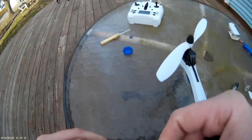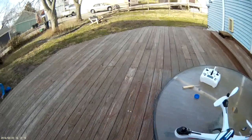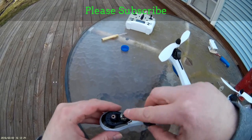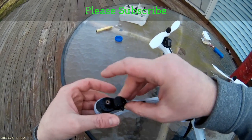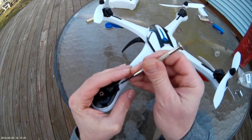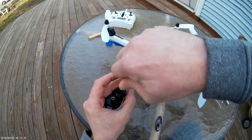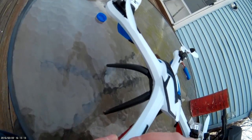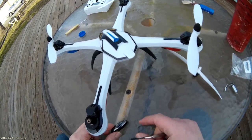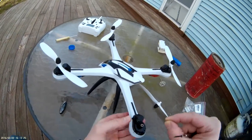There's a lot of traffic — lots of loud cars, hope you can hear everything. Alright, now that you've got your wires tucked back down in there and everything's plugged in, set the motor cover back on here. Get the screw on the end of your screwdriver and carefully drop it down into the hole and screw it down. Make sure you're not pinching any of your motor wires.